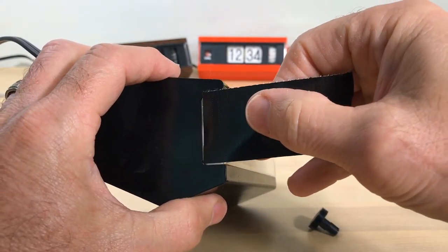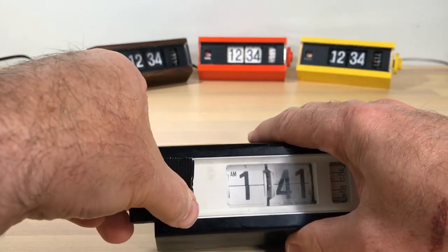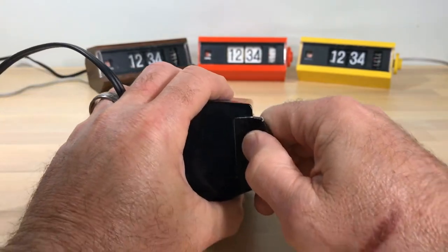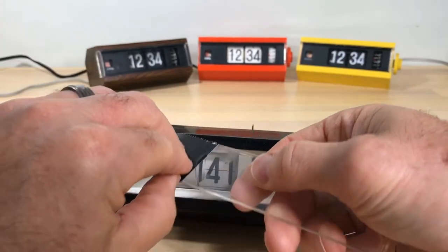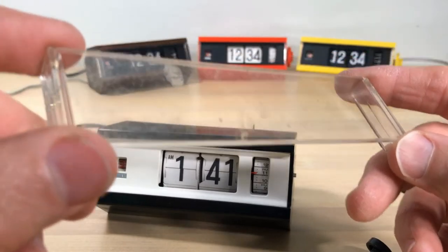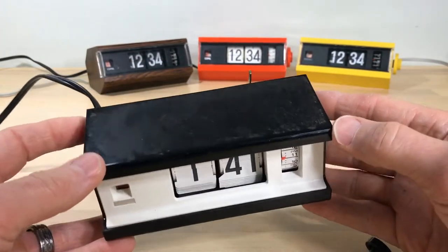We're going to use a piece of tape to get the face off. Now the last time I did this — just the last video — I don't think I specified the amount of force you should use. You put the tape on the side, cover it over a little bit, then fold it to the side. You're not pulling with a large amount of force; you're just releasing the tab set into the side, then push it off the other end. Remove the tape and it doesn't cause any damage to the plastic — no scratching, no marring. But as you can see, this is in pretty rough shape. I can see some evidence of damage — I hate to see that, but we'll see what we can do.